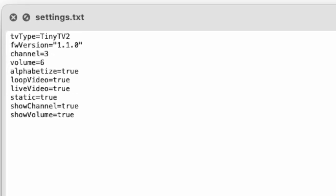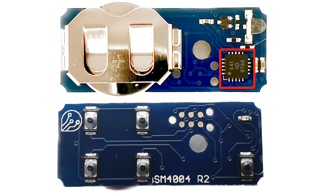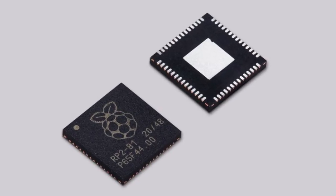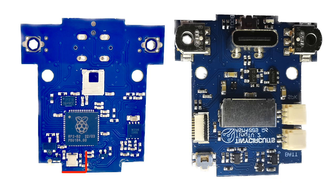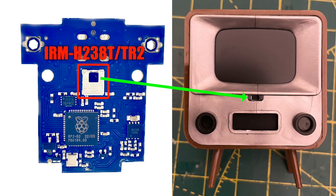The settings file contains a few interesting things, such as the current volume, channel, and a few other bits and pieces. The remote control is pretty simple — we've got an ATtiny441 doing all the hard work, along with a transistor for driving the infrared LED. The main board is a lot more interesting. It's all based around an RP2040, which has got really popular over the past couple of years. We've got the crystal down here for its clock, and here's the flash memory for the firmware. Over here we've got the audio amplifier for driving the speaker, along with its supporting passive components. And we've got the IR receiver, which matches up to this little window on the front of the TV box.